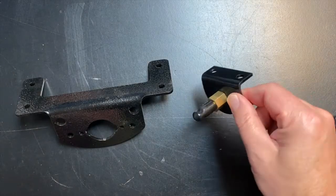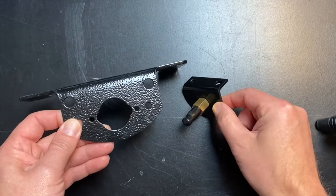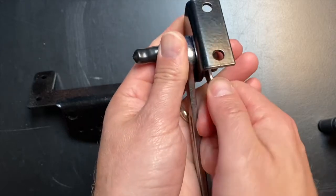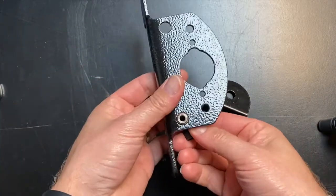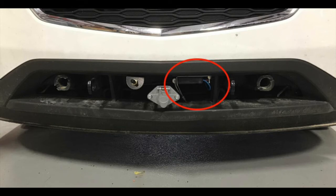Let's move to mounting the air fitting on the front of the vehicle. You have a few options: first is using the standard L bracket that the air fitting comes on — with a couple self-tapping screws this can be easily mounted on the front bumper. Another option, if you install the Demco base plate, we provide a mounting bracket for the towed wiring with extra holes to mount the air fitting. To do this, unscrew and separate the air fitting from the L bracket, then choose a hole on the base plate mounting bracket and screw the air fitting in and tighten it down with wrenches. For the breakaway switch, we provide a bolt, washer, and lock nut to mount it. Use either an existing hole or drill a hole in the bumper. When you tighten it down, leave it just barely loose enough so it can be swiveled out when in tow and swiveled in when not in tow.